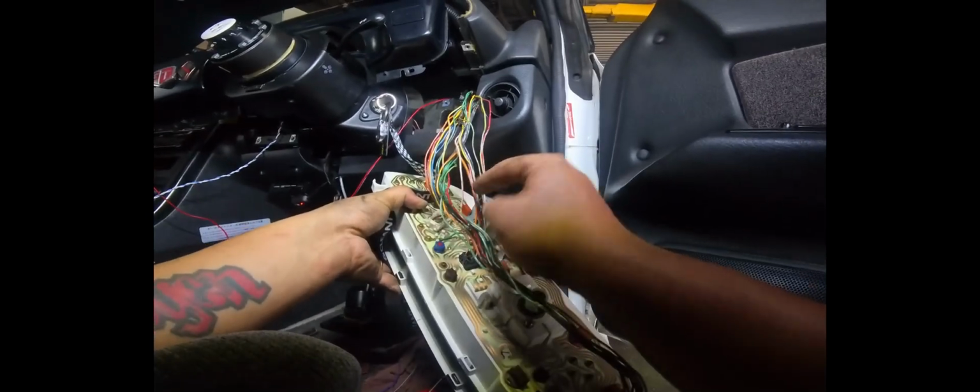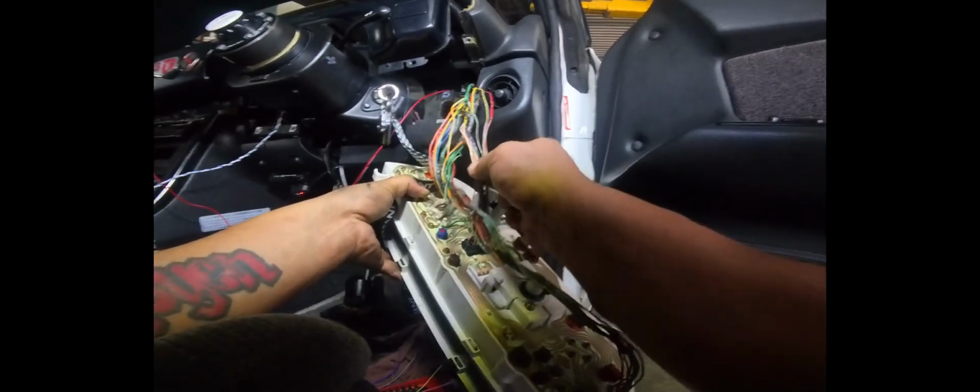So it looks like the yellow red wire here is our 12 volt power. So we're going to put a resistor in between these two. We'll cut this in and then tap a resistor into here, and then we'll put them together, and that should allow it to charge. Okay, so what we need here is a 470 ohm resistor. I don't know why it's a 470. I'm assuming it's like the resistance of the bulb itself is 470. I don't know. It's just what we've used forever, and it seems to work. So that's what we're going to do.